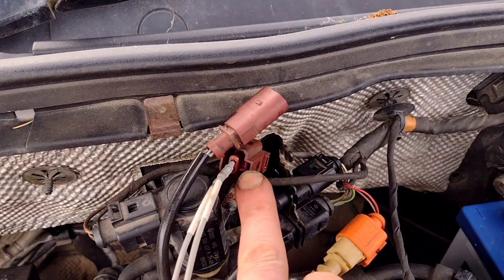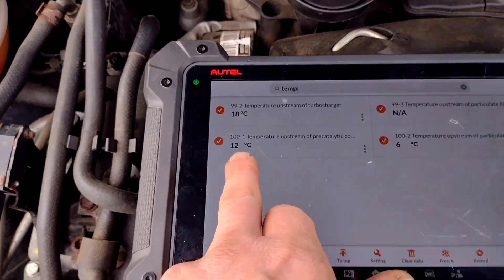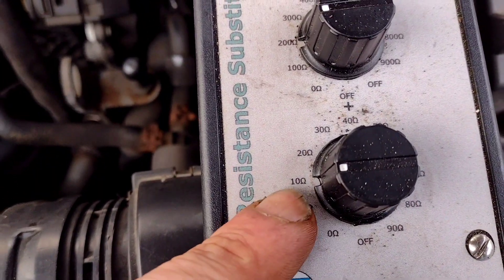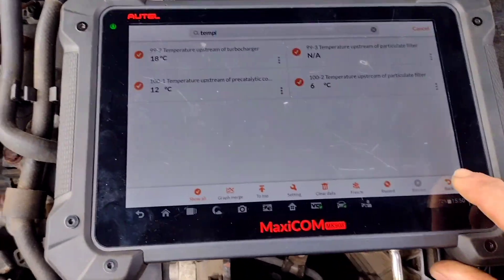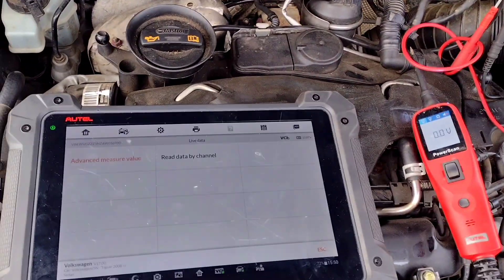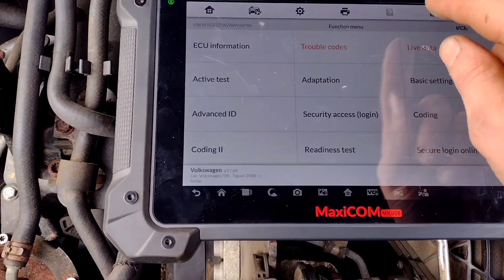What I'm going to do now is put a resistor into the wires on that plug - that's the car's wiring harness side. The reading that was up at about 900, I've now got it down to 12 by dialing in 210 ohms, and that's brought it right down. So that looks good. Can we erase the fault code? We've definitely got one that's affected the reading, so we know we're on the right wire and we know the wires are okay.